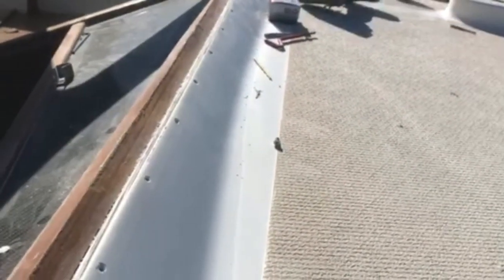Let's see if we can see the shine I put on there and buff this surface up to a shine. Done that because the window's out, sander sits flat, don't have to worry about going around the window edges, knocking the anodizing around on the window. And eventually this whole boat will have to get cut and polished, but we'll just do it in little stages like this. Make life all very much easier.